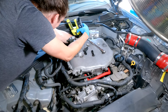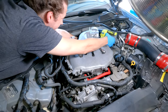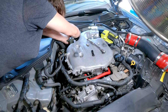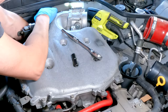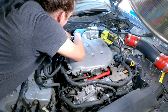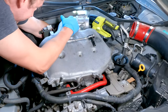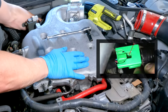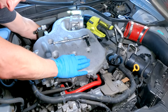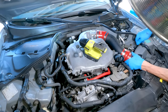Push the new sensor in until it pops, and you can put a little oil on that rubber o-ring to help it slide in. Doing this mostly by feel — with one hand find the spot, then hand the part over with the second hand so you know exactly where it goes. Rotate the sensor slightly while holding the bolt to hand-thread it. Once it gets started it's easy — hand tight, then a little torque with the wrench. Clip the sensor back in, make sure that green tab is popped all the way out, push the clip in, and listen for a nice click to confirm the connector is secure.